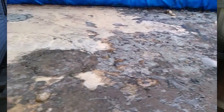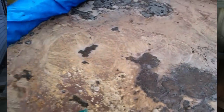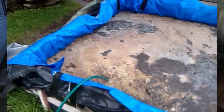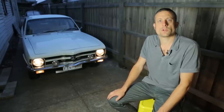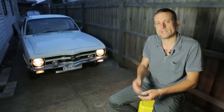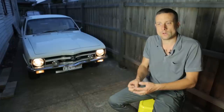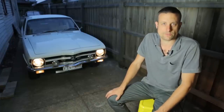I'm still pleased to say that molasses is the best option for rust on steel. For steel, you can leave it in there as long as you want. But as far as fiberglass, body filler, bondo, paints of any kind — a long exposure to molasses I would consider a risk and to be avoided.